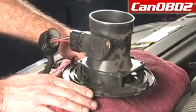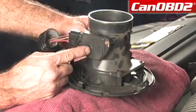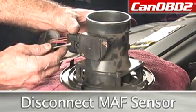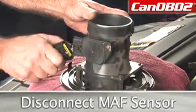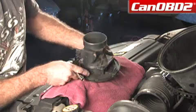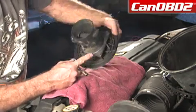This is the unit we're going to be replacing — this is our mass air sensor. We're going to reuse this connection again. We're simply going to take our screwdriver, reach in here, bend the tab down, and gingerly take this apart and set it aside. This is the mass air sensor unit we're replacing. There are two bolts here and one on the opposite side with two guide pins.